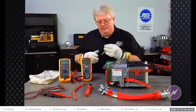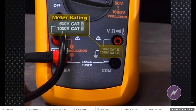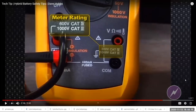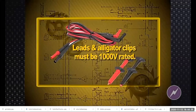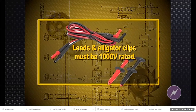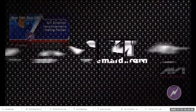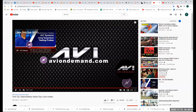You can find the rating of that meter down here in the lower right-hand corner of all of the products. No matter what brand of meter it is, it will say whether it's CAT III 1000 volts or not. CAT stands for category, like CAT III 1000 volts and CAT IV 600 volts. So make sure not only the meter is specified to that degree of protection, but also make sure the leads say 1,000 volts, as well as the ends, the alligator clips or probes. So, hardcore stuff. Not stuff to be messed with